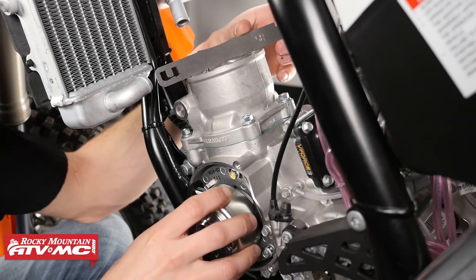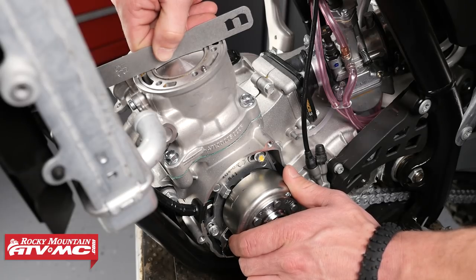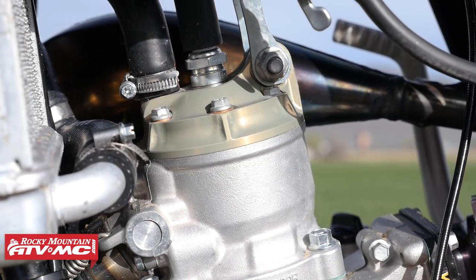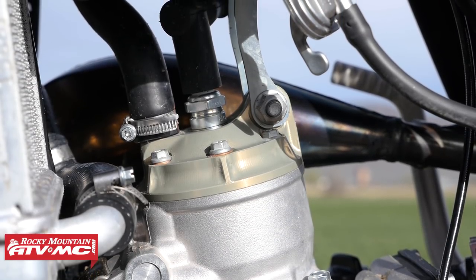The first thing we did, we got the bike straight from KTM and wanted to make sure everything was in spec. We checked the timing, the decking, and looked at the power valve to make sure it was all in spec. Then we added the KTM hard parts high compression head. The stock bike runs about 165 PSI, and we wanted to punch it up to about 180 PSI. That gives the bike a little more bark, a little more bite out there on the track.